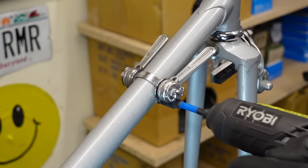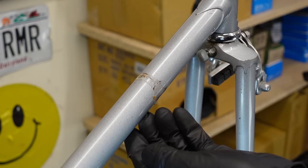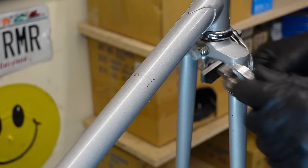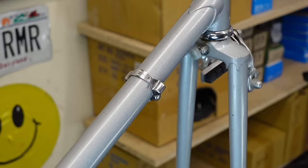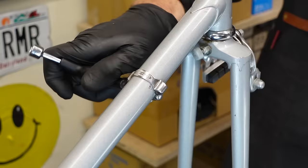So we have to take these shifters off. And this bike is from before they were putting bosses on them. There is a little stoppy thingy brazed down here. That's kind of neat. That cleaned up. Alright, here's an old Shimano cable stop strap thingy. Whoops! That was not an ope. I didn't really drop it the whole way. Made a quick little modification to this bolt off camera to get it so it stops spinning. Get a good clamp on it. That ain't going nowhere.